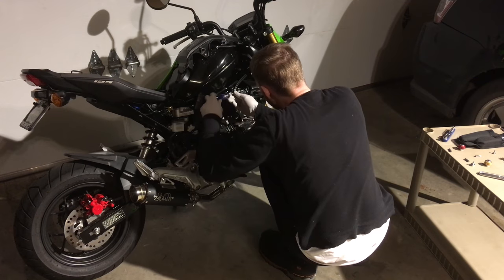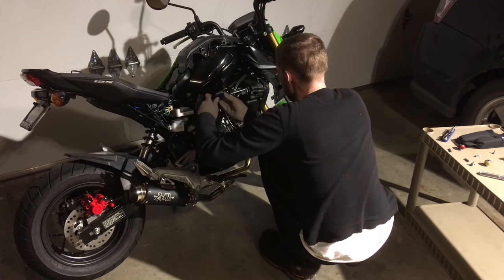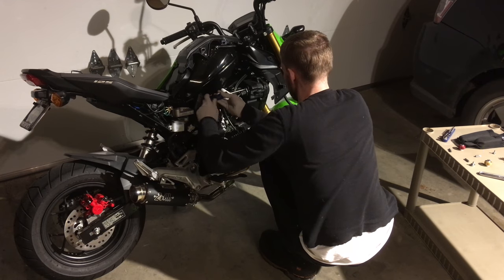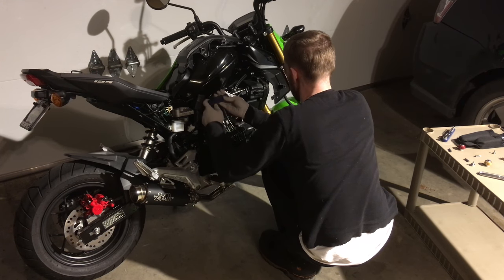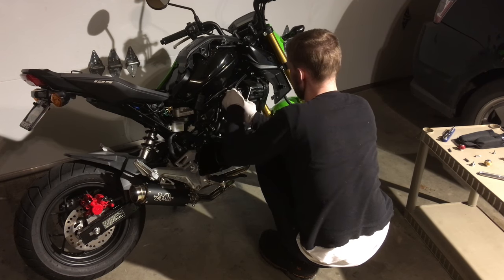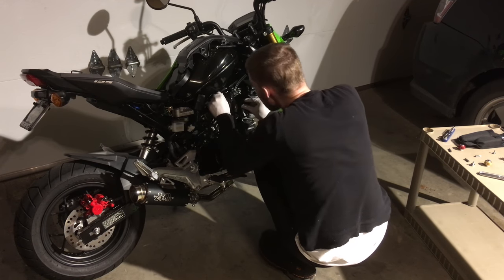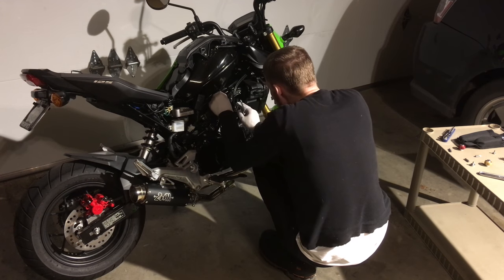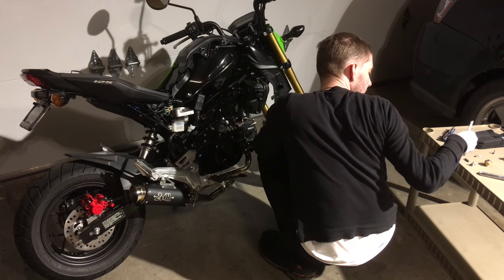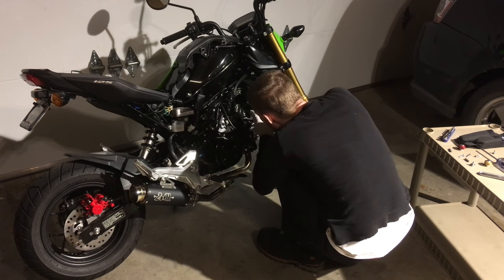A free-flowing engine with aftermarket exhaust and air intake can breathe a lot more easily, and in an air-cooled engine like this, this could cause the temperatures to get in excess of 210, and that's bad because high oil temperatures are essentially bad for the engine. Under the worst case, if you're revving it to the moon, north of 8,000, and overheating the engine, you could actually melt the aluminum piston to the cylinder wall and effectively brick your motor. That's a pretty involved procedure to undo, so it's better to be safe and use an aftermarket fuel controller.